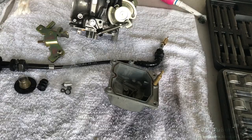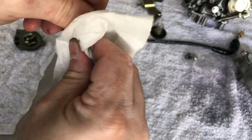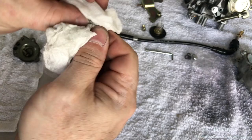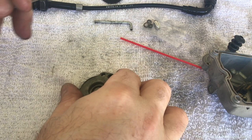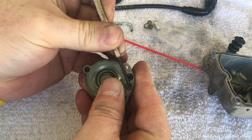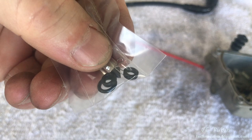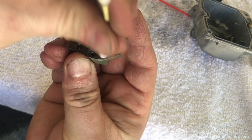These corroded areas will get extra attention to ensure a leak-free seal for the gasket. We'll put the new dust cap for the accelerator pump rod on — this was provided in the kit. This piece is going to be polished to remove oxidation so there's no binding. Then cleaning up the three screws that hold the accelerator pump. Looking at the bottom cap of the pump — it's dirty but there's no gas rot. It has two seals, so I'll gently pry them out. We have replacement seals in the kit, one side is flat and the other side is round.